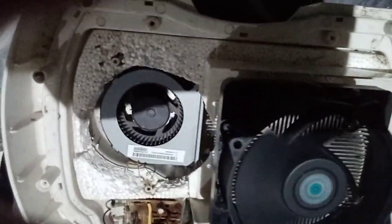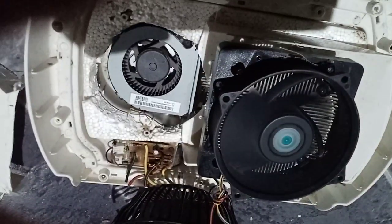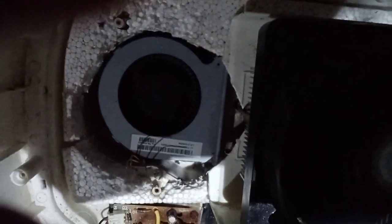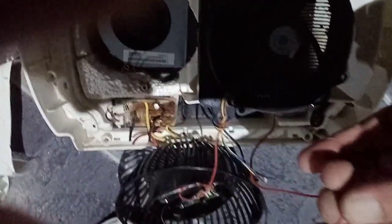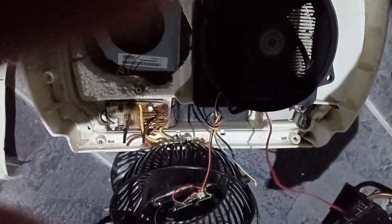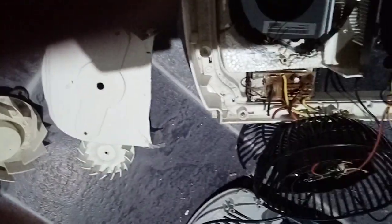The plan for this chilli bin is to run off batteries and USB. Initially, the USB will power just the fans and cooling plates. If you want the powered cooling plate running, make sure it's definitely wired to 12 volts — don't use small batteries as they'll go flat very quickly.